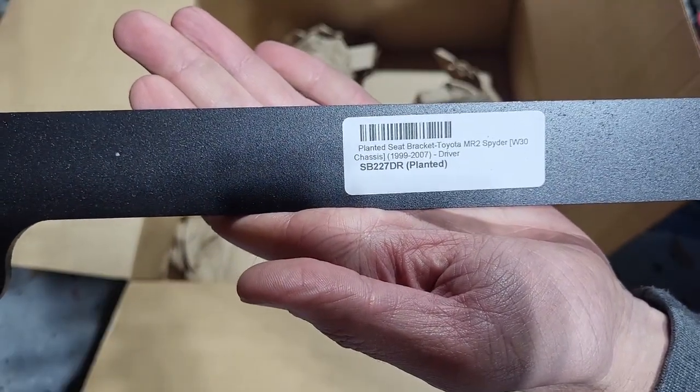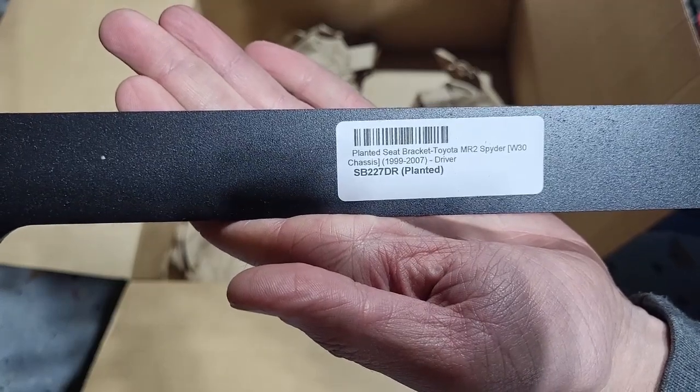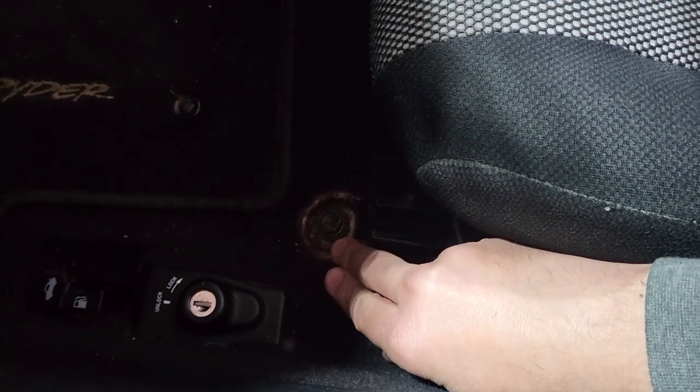Here's the part number for the driver's side seat bracket. I'll leave the link for it down in the description. Next, we're going to be taking out the four 14 millimeter bolts. There's one here, one up over here. Maybe two more behind the seat. Three, and the fourth one should be underneath this little plastic cover right here.